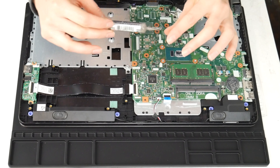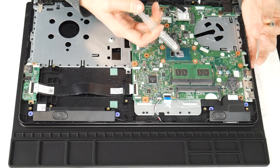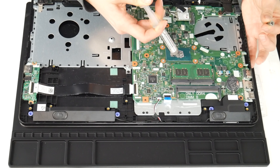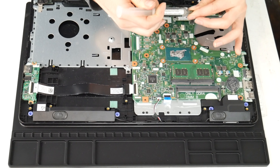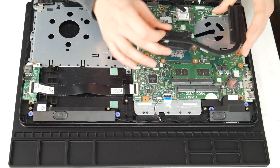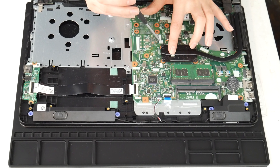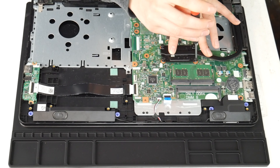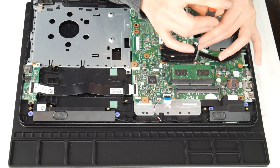The next thing I'm going to do is use some thermal paste on the CPU. I forgot to clean off the CPU before doing this, but I do recommend that. As you can see it's dried out and there isn't much on there, so I go ahead and put some new thermal paste. I've put a link down below with some good quality thermal paste, because not all thermal paste is created equal — you've got to get the good quality stuff. As you can see, put your heat sink back on; there are four screws and it's kind of like putting a tire on. You have to go one screw and then across to the other at an angle so that you don't get one side tighter than the other.